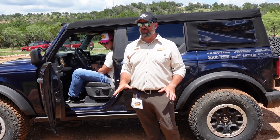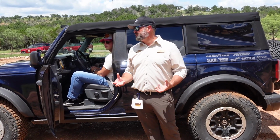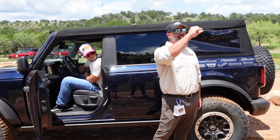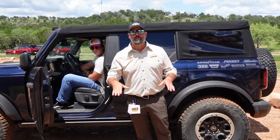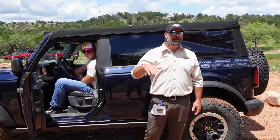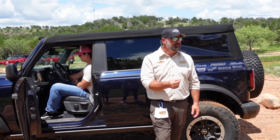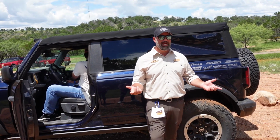That's our parking procedure. Why are we doing that, folks? Has anybody ever seen the inside of an automatic transmission? Seen what a parking pawl looks like that actually holds the vehicle? It is a pin about this big. That is all that is holding our vehicle when we put it in park. Well, that may be fine when we're on flat paved ground. We're off-road, we have hills, angles, all of that stuff. So we want at least 2 steps of safety there. Our parking brake, then that parking pawl is there to hold us. There may also be a time that we use 3 steps. We'll talk about that in another minute.